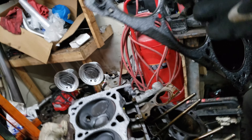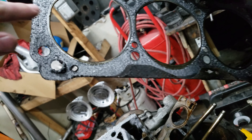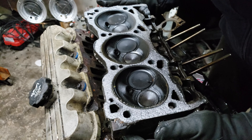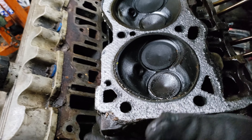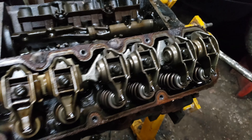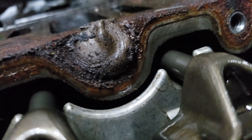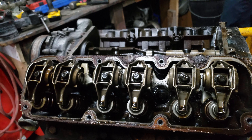This is why supercharged motors are awesome — the NA motors don't have this. GM just doesn't give a fuck, their quality control is shit. All my valves look good, valves are all in one piece. That seat looks okay — alright, to the other side. I hate how clean this motor was — usually you see a nice golden brown, but this shit is silver, that's bare metal. I can't believe I had that much gas in my oil — that's the only reason that shit's that clean.